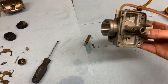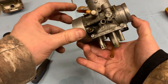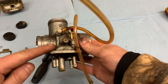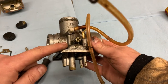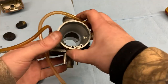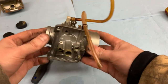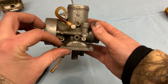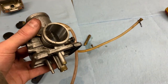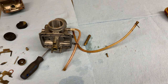That's pretty much everything I'm going to disassemble. I'm not going to touch the idle screw and I'm not going to touch the air-fuel mixture screw. This one right here is the idle screw — you can see that stud. Turn it clockwise and you push the stud in further, the throttle slide moves up, you get a higher idle. That means the other one is the air-fuel mixture screw. I'm not going to take that one out because it's not really important for cleaning purposes.